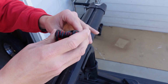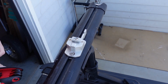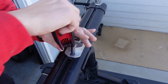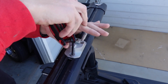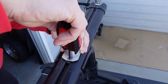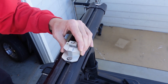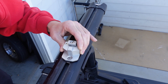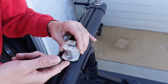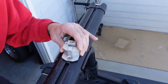All right, so I got my Allen wrench tool. Go ahead and find the right size. Looks like it's 5/32. So if I tighten this guy, it already maxes out right there. So this amount plus the gap underneath that nut is what I have to cut this off. So I'm gonna go ahead and get a tape measure and look at that.